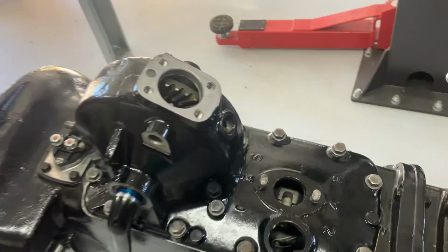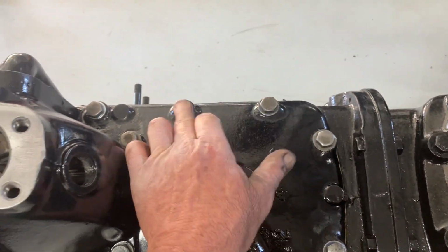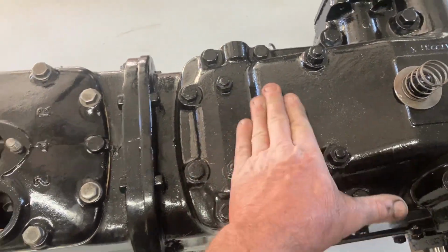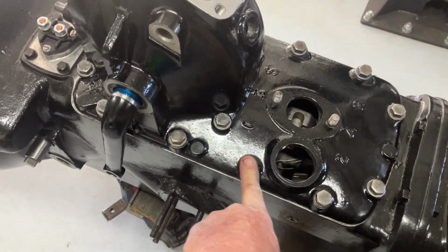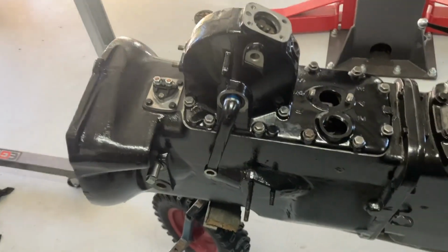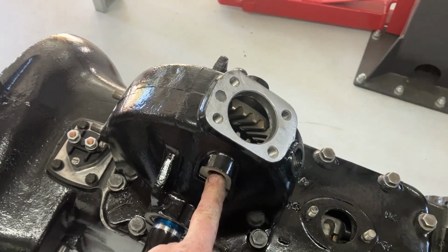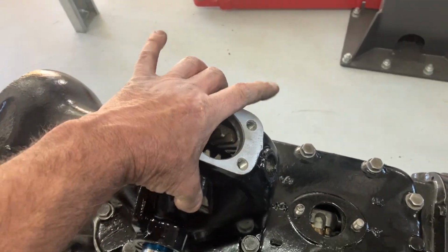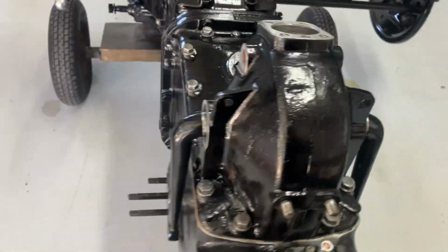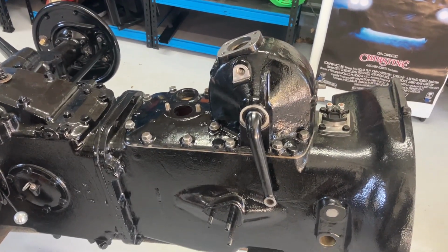What I'm going to do now, I'll just get a tin of black spray paint. Just touch up the bolts, just so they marry up with the rest of it, like down here and that. I put a little bit of copper coat on them. They're a steel bolt into an aluminium housing, just in case they tend to want to bind or gall. It's just a bit of anti-seize. I'll talk about these adjusting screws in a minute. So, we're starting to look all right. We'll keep going.